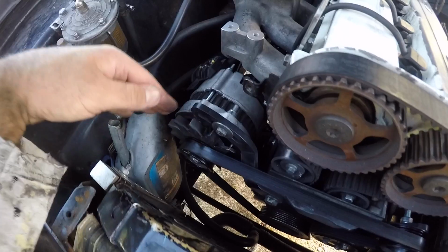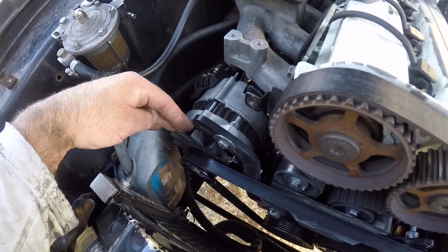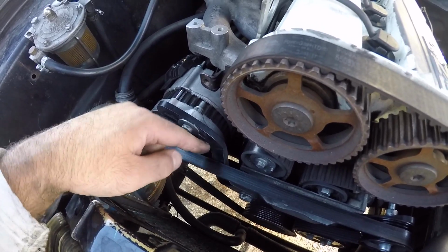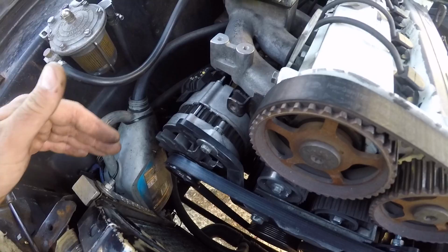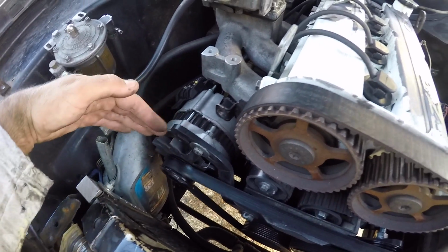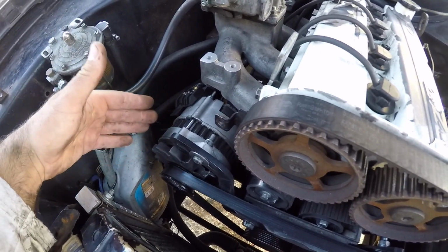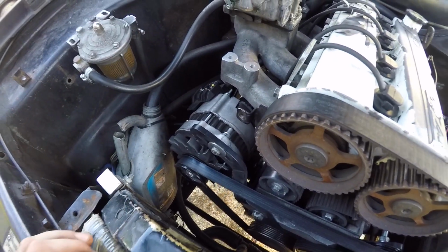Now, before I crack on with anything else, there is one thing I forgot to mention yesterday about the problem I had with the alternator fan. A couple of times since I fitted this alternator from Retro Ford, the fan was bending outwards and it started rubbing on the belt and the bracket. And basically, I took the alternator apart and straightened out the fan and then refitted the alternator to the car. Now, obviously, where the fan had been bent and straightened, that had weakened it, and that is why the other day it went bang and failed on me.